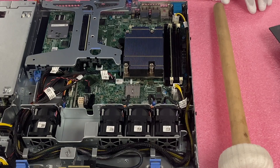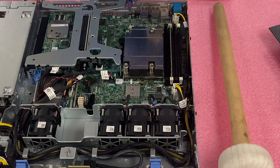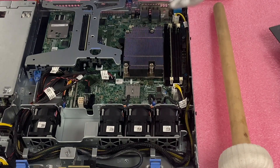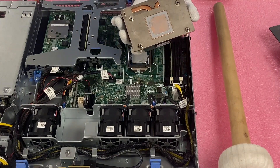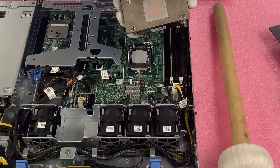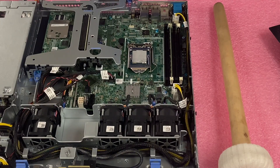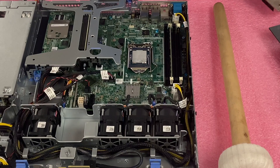So now we're going to lift it up. Since I don't know who installed this, when I lift the heat sink up I don't know how much thermal paste is going to be under there, so I like to flip it over right away just in case there's a bunch hanging there — you just don't want it falling all over the place. You can see this is older and it's definitely caked on there — this is the kind of thing that can flake off and get all over everything. So I'm going to clean this off screen to avoid accidentally getting anything onto the motherboard itself.